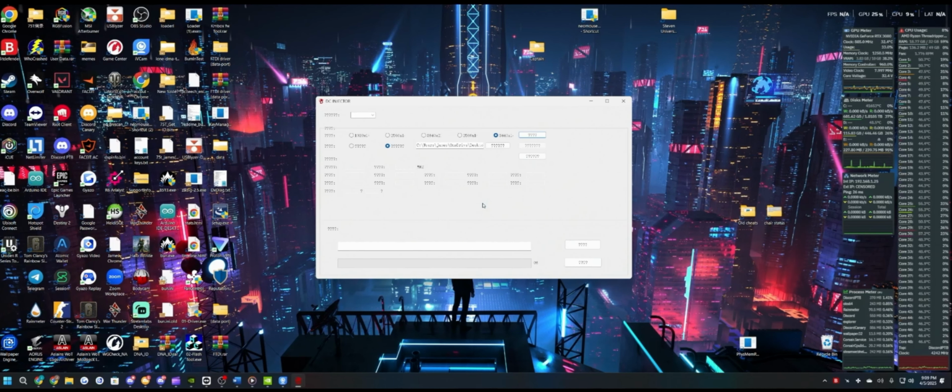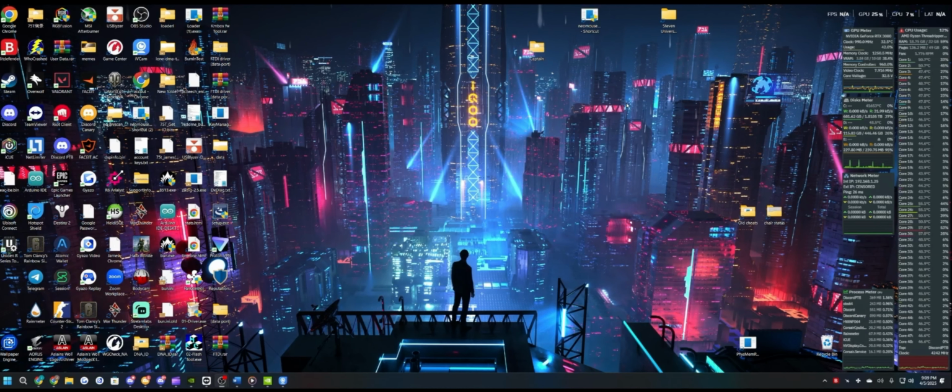Your screen should go black and then turn back on, and the lights on the fuser should also turn off and back on. If it did not turn off, you didn't flash, and you probably need to install the driver or try on your other computer.